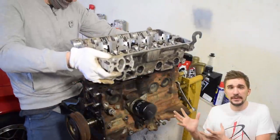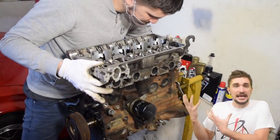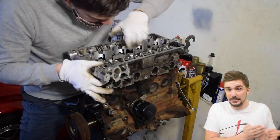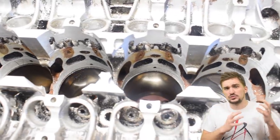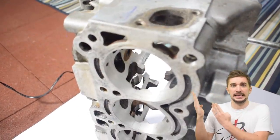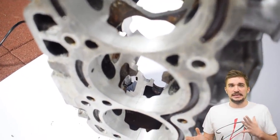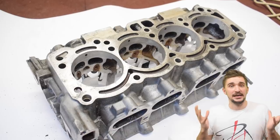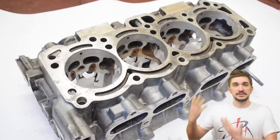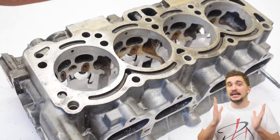The total cost of making a torque plate like this will be anywhere between 75 to maybe 250 dollars — still a lot less than the typical ready-made torque plate, which runs 400 to 750 dollars for an inline 4 cylinder engine. Also, this should be a better torque plate because it's not some random solid piece of metal — it's an actual head, made from the same material and with the same internal wall matrix structure as the head you will install on the block. It better mimics a head because it is an actual head.